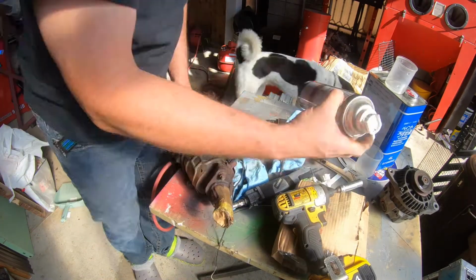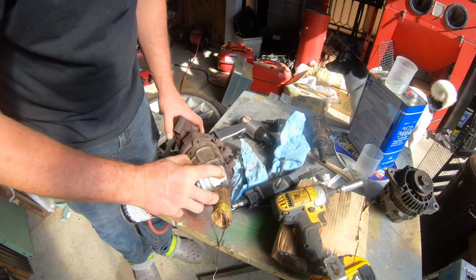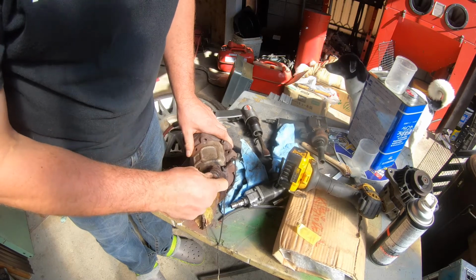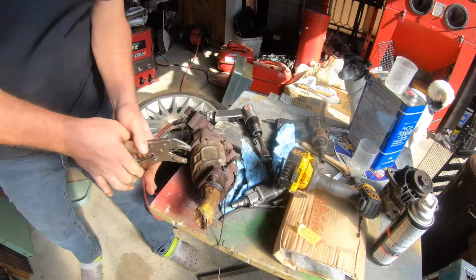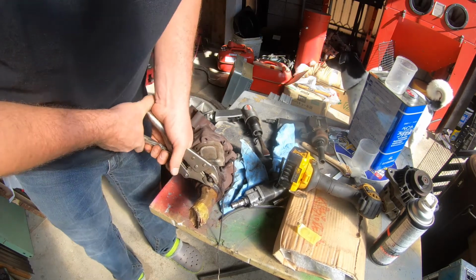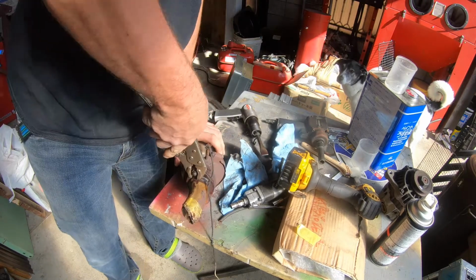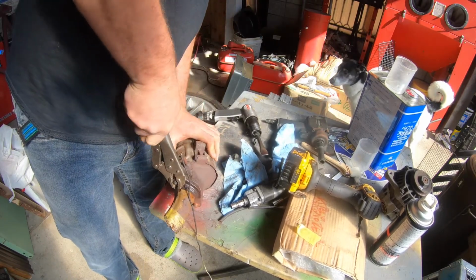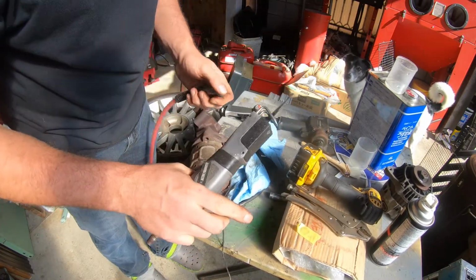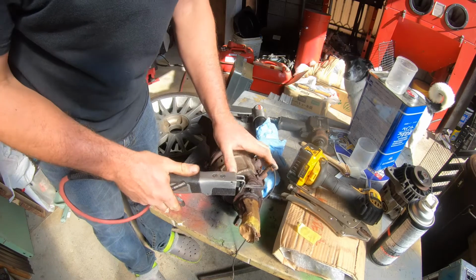So yeah, this is Loctite freeze and release 1620. As you can see, it's been rounded off by the previous owner. They would have tried this and failed multiple times to get it that round. So we're actually going to get it out. Very slow process using an air saw. You could use an angle grinder, but I'm out of blades, so I'm going to do it this way.